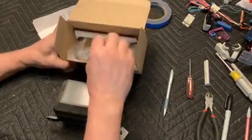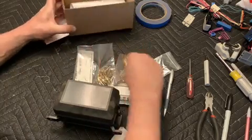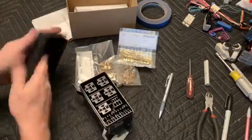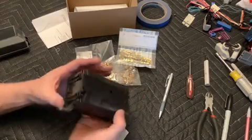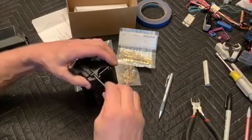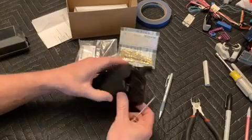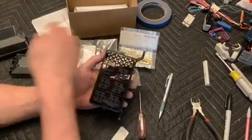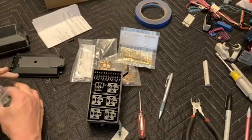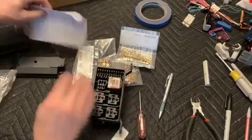Now, the second one is a little larger in form factor, but everything fits inside and underneath the one cover. Again, comes with all the different connector pins. Actually, this one comes with 1 page of instructions, but take the top off, and then you can see where you can put 5 regular relays as well as 1 smaller relay, and then I fight with getting the bottom off, which I guess is good because it means it's not going to be falling off all the time. So with this apart, you can now see the bottom side. We have area to plug in all of our relays and our fuses. Now this one only holds, I believe, 6 fuses, and like I said, 6 relays, 5 of them the normal form factor, and then one of them smaller.